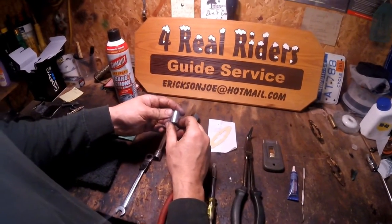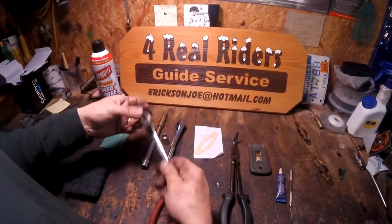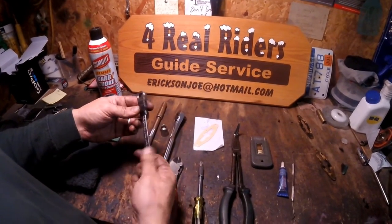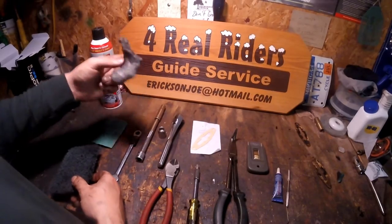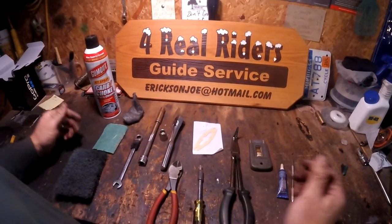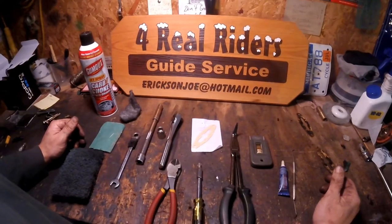This is for taking off the bolts for the steering shaft. I've also got a 10 millimeter ratcheting wrench. It works really nice for getting the covers off the exhaust valves, one bolt in particular. I've also got the Scotch-Brite pad, some heavy sandpaper, steel wool, and of course carburetor cleaner. This is pretty much what you need to get the entire job done.